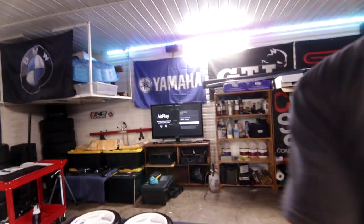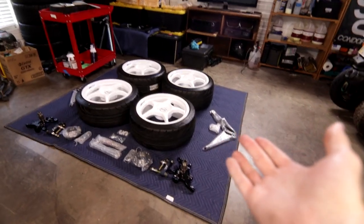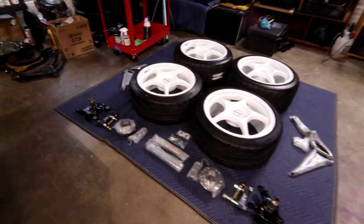The control arms on the car were already kind of worn out and needed to be replaced. 97-plus M3 control arms are not cheap, so I started thinking — that starts to add up. If I just put new control arms on, then I started thinking about the tie rods, and fitment stuff, and what if I just get extended control arms? It's a drift car and I'd like more angle. But I didn't want to just do extended E36 arms and have stock angle, or use those crappy angle blocks, or mod the knuckles. So — screw this. It's eventually going to have an angle kit anyways, we might as well just do it. If this is going to harm me in learning, so be it. The car's going to look sick and I'm going to have fun no matter what.